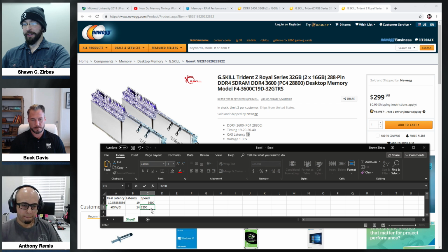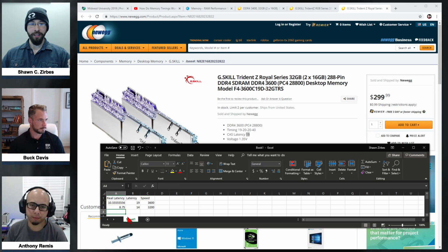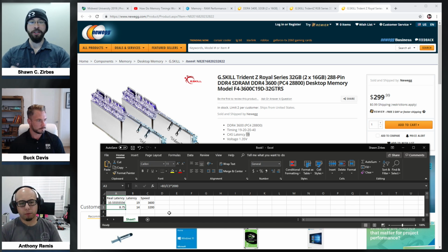What was it, 3200? I think we had that in the other one. Yeah, correct. So we can get those exact same numbers that you were talking about before. It's latency divided by speed times 2000. That's the basic math there. And so we get the real latency based on that. So we get the same numbers that Anthony was mentioning earlier.